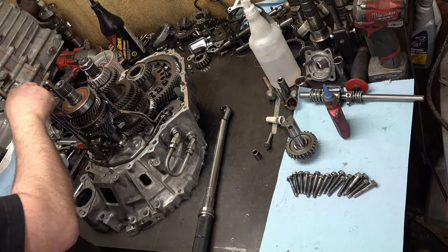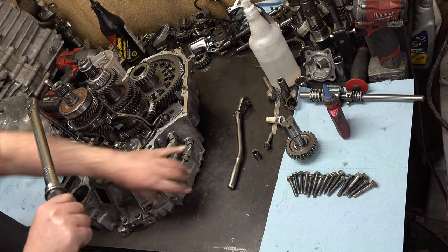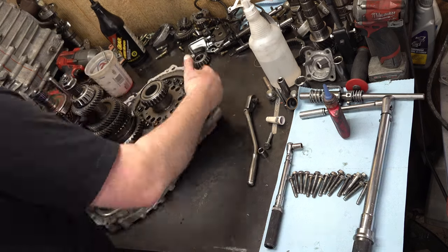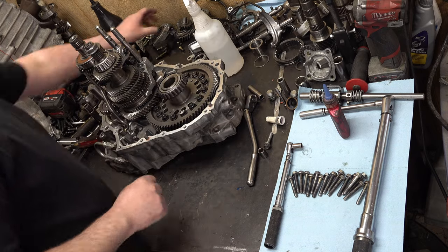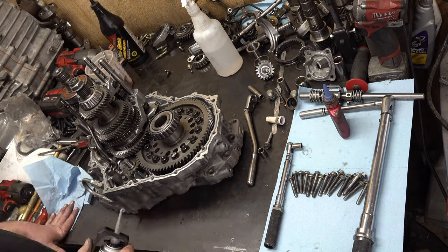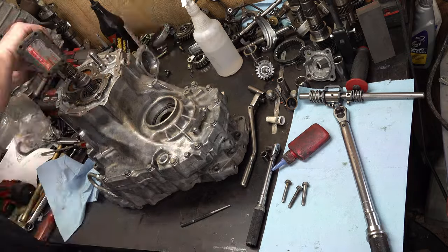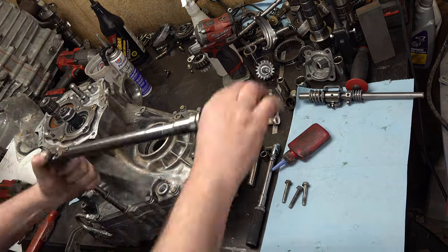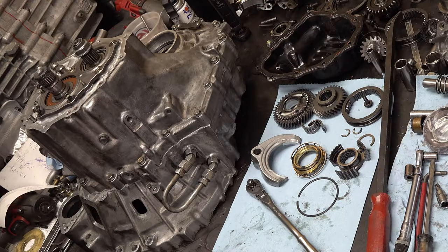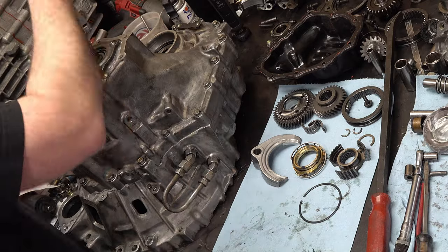And there you go — there's all of the internals, at least the internals for the mid case. Clean up that outer gasket seal one more time, make sure there's no oil on there, and then we're going to use RTV and seal it up. Almost forgot — without this we would not have had any oil pumping. You want to make sure this reverse bolt lines up early because otherwise you've got to take the whole thing apart again. Now it's time for the fifth gear assembly — one thing we can't forget is the snap ring. Now that the input shaft's in place we need to add a lock tab, so it's got to come out anyway.